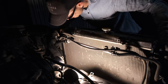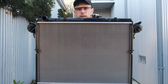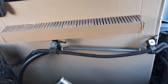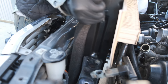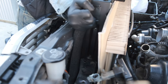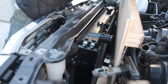One additional note: you might have to remove the entire battery — for me I just could not make enough space to get the radiator out otherwise. With that out, now we're ready to install the new radiator. Here's a quick look at mine before it goes in, and don't forget that you need to save the brackets from the old radiator. I used the cardboard it came in to create a little barrier between the radiator and the AC lines. This just took a little bit of finagling to get down there, but you have pretty good handholds on the radiator. The only real challenge was getting hung up on some of the lines, but moving the radiator back and forth left to right I was able to get it situated on its mounting points.